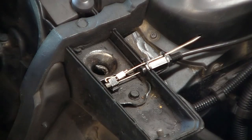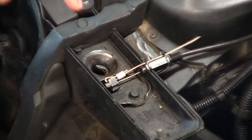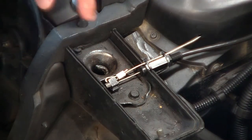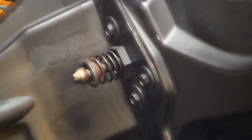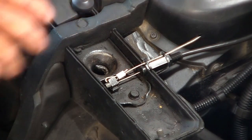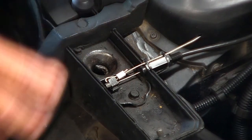This is a very important part of how the latch works. As the cable comes across, it actually opens up the little unit here that releases the hood. As you pull it back and forth and open it, you can see how the latch opens up and releases the hood. The hood pops up with the spring and away it goes, nothing to it. But if that cable breaks, you're in deep trouble because it won't open and your hood is locked down.